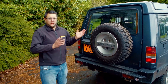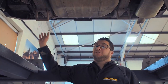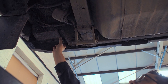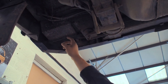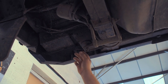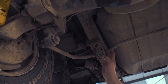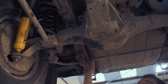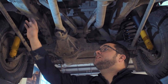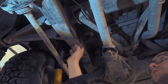Now heading into the workshop to look underneath at all the rust spots. The first thing to check at the back of the vehicle are the two rear body mounts on either side of the chassis. The rear cross member is quite a big job to replace when rusty and getting the body aligned properly again afterwards can be tricky, so make sure they are solid. Most Discoveries would have had anti-roll bars fitted at the factory but quite often they've been removed as they tend to limit axle articulation off-road, so make sure they're still in place. Check for off-road damage on the rear axle and chassis rails — if it's knocked any paint off that can start corrosion.